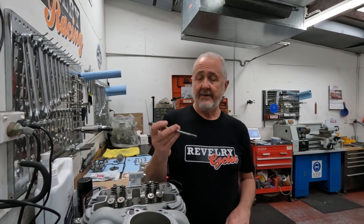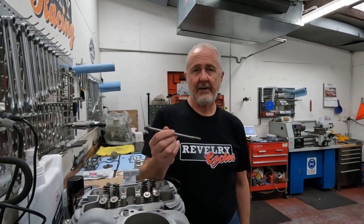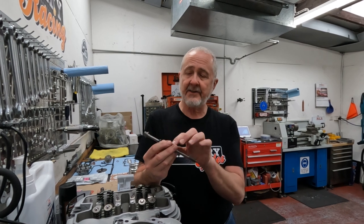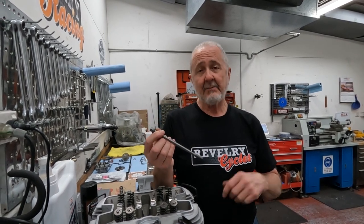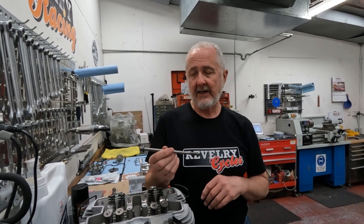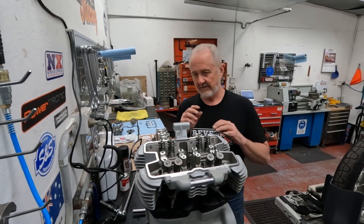After cleaning the holes clean and dry, put a drop or two of motor oil on the threads and a couple of drops on each side of the washer against the bolt head. A lot of the tension and torsional force is lost between the bolt head, washer, and threads. If you put this together dry, it will come up to torque spec but still not achieve full clamp load due to frictional loss — so you must oil the threads and both sides of the washer.